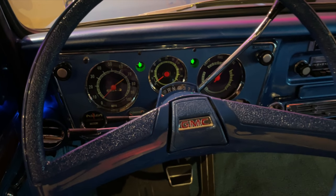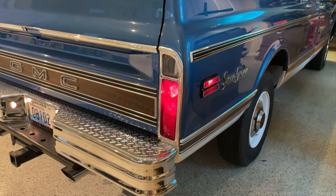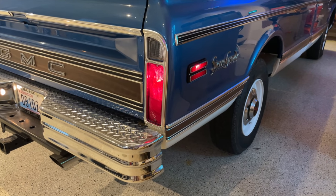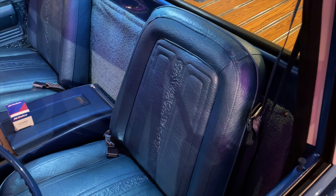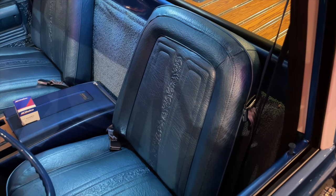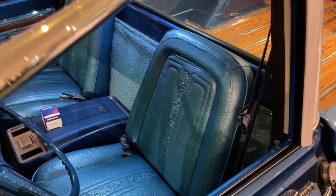As far as getting rear-ended is concerned, these trucks have tiny and dim 26-watt incandescent brake lights — one per side — and no center brake light at all, since those weren't introduced until sometime in the mid-1980s. They also completely lack any form of headrest, which means if and when you do get hit, your head bounces off — or worse, maybe goes through — the back glass. Over the years, my dad was rear-ended in his, as was my neighbor, and both received whiplash injuries and minor head trauma from this sketchy setup.